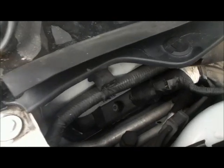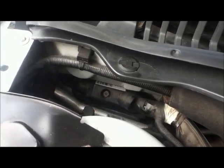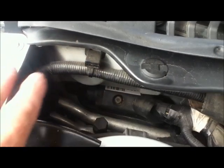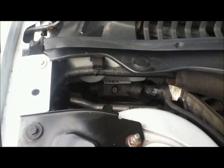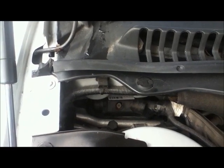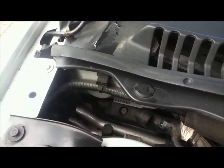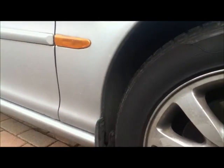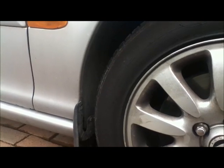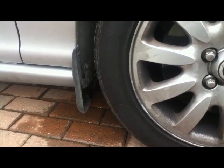My final conclusion is that the ECU can only get drowned if this hole is blocked up with debris and the water can't escape. Given that my car is nearly 17 years old and it hasn't happened yet, I don't think it's ever going to happen. This must be something to do with local problems with leaves in the engine or rubbish. I have seen someone do a really good video on taking out the packing behind the wheel arch. I started to have a go at that but couldn't get any of the fasteners off without destroying them, so I gave up. You can see that the water is dripping out the bottom, so it's not being held inside the wheel arch — maybe that's a job that's already been done.